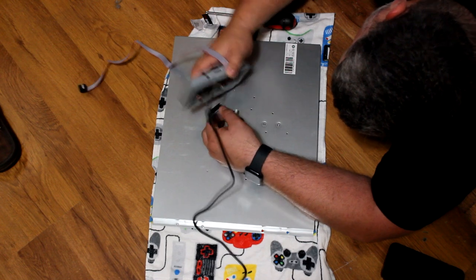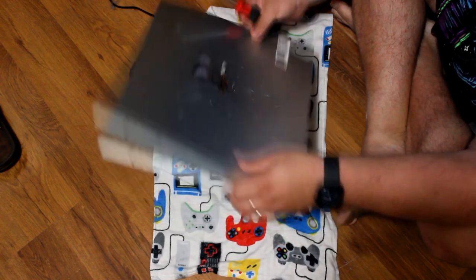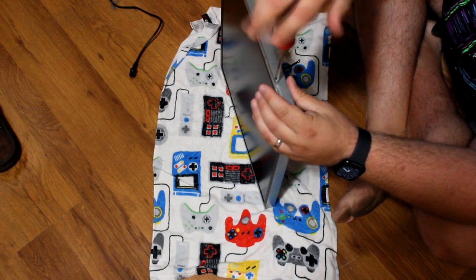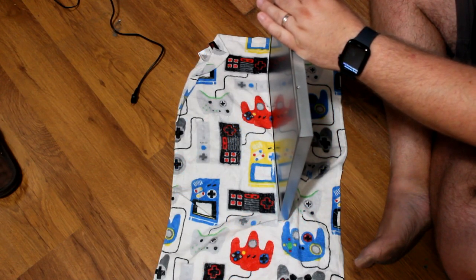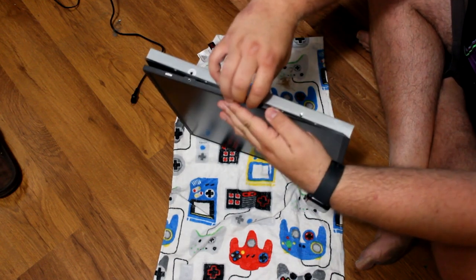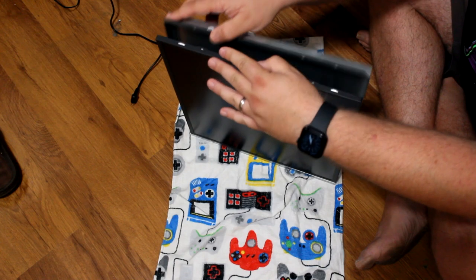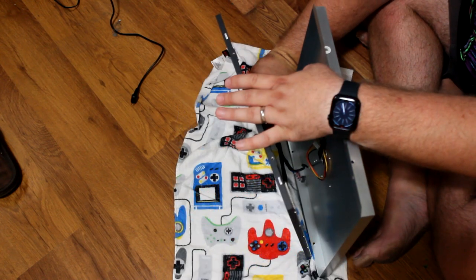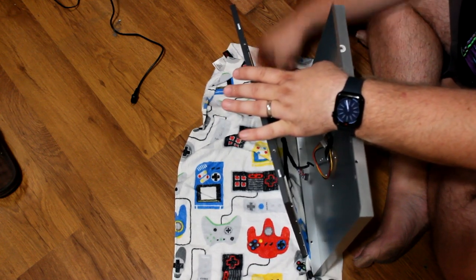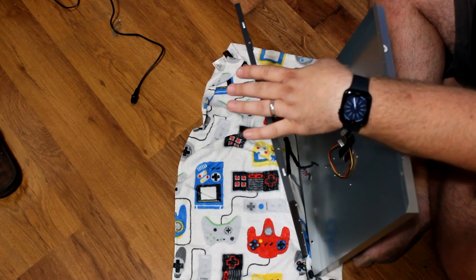Once everything's out, we're going to move the cable away and take the back off the monitor. Taking the back off isn't hard — you just unscrew the four screws, then disconnect the cables once you pull the monitor out. The monitor just kind of lays in there, so you need to get it to come out a little, but make sure you have your hand in front because there are cables connecting this on the inside that we'll have to disconnect. They're not too hard to take apart, though I was super nervous — it was my first time doing this particular mod.